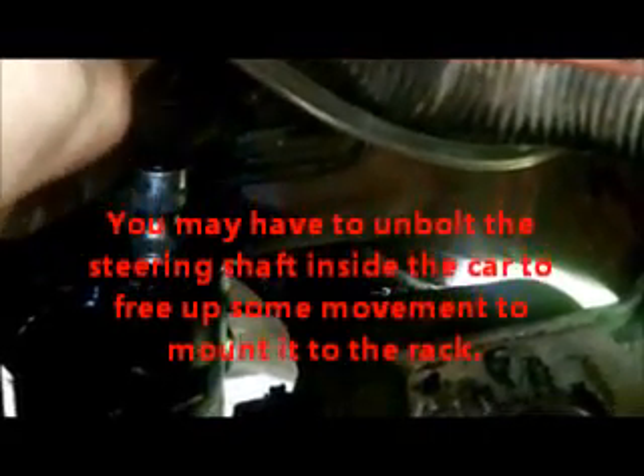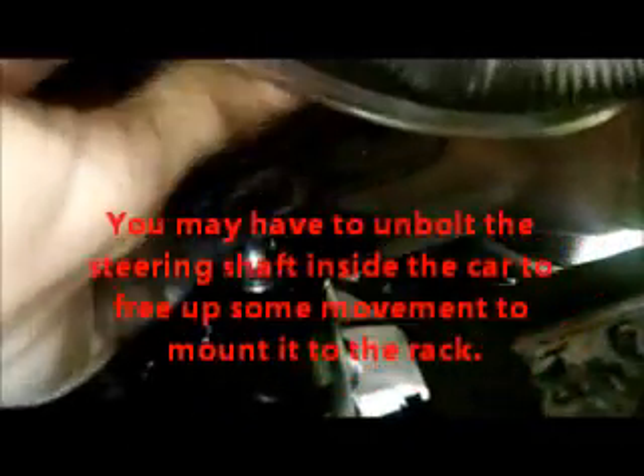The two lines are tightened — you don't need to tighten those very much, just snug them up. The instructions said no more than 15 foot-pounds, but since you can't get a torque wrench on there I just did it by hand — tight but not way tight, just medium tight. Also make sure the threaded side is facing down so the bolt head faces up and you can actually tighten it.